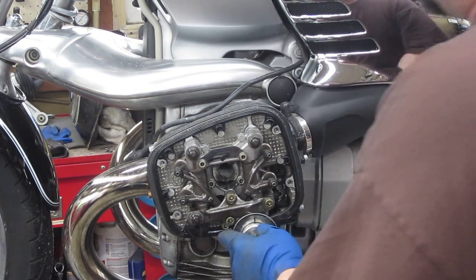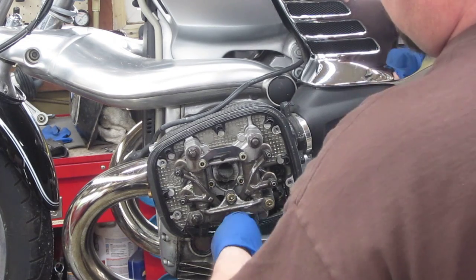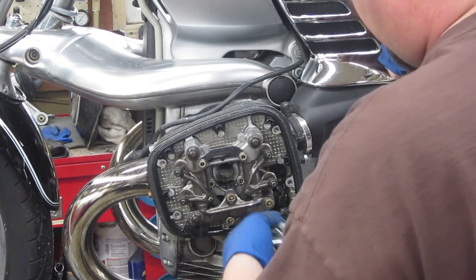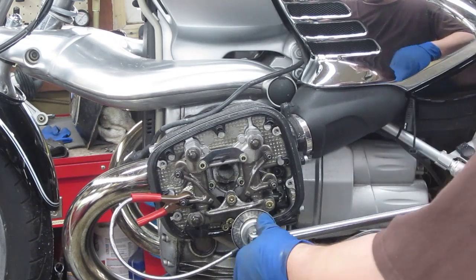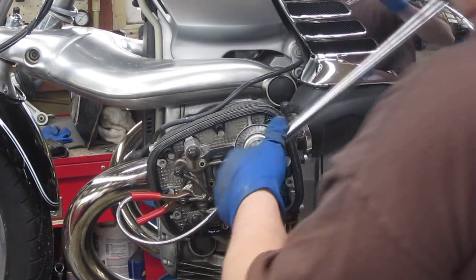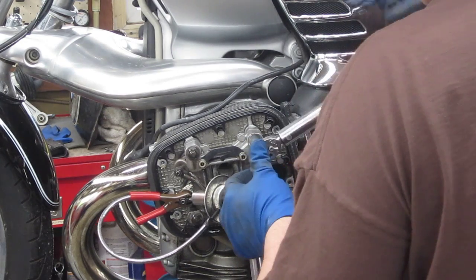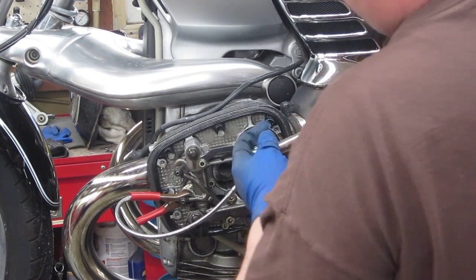Pay attention — this procedure is easy to mess up. You get distracted, you forget which ones are done. I've seen it too many times. A technician will turn it 180 degrees, forget, come back thinking they didn't do it, hit it another 180 degrees, and the cylinder studs ripped out of the block. We got a '93 R1100 RS in recently that had that exact issue, due to negligence from a former technician.